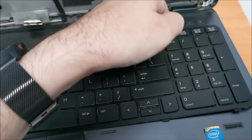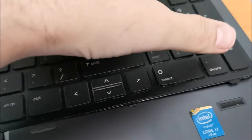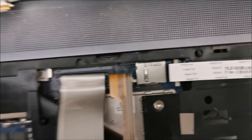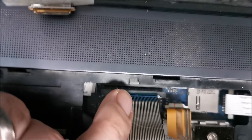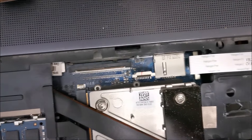I was right — this was the area where to push, but I literally needed to push like I was trying to break apart this keyboard. It even popped the clips from underneath instead of just lifting the corner — it was so badly hooked in there. We should be getting the top of it out. It went out finally. Now we should pull it from underneath. In here we have the connections which we will undo — lift in there, lift in there, the black plastic — and that should release our keyboard. Still not coming out. Does some corrosion also reach this? Doesn't look like it.